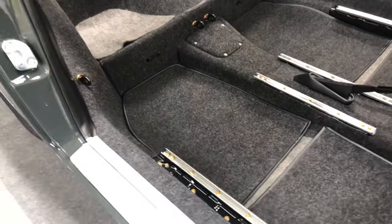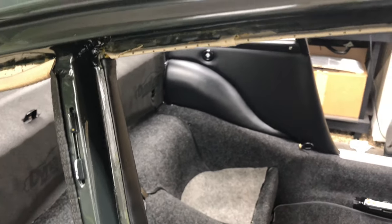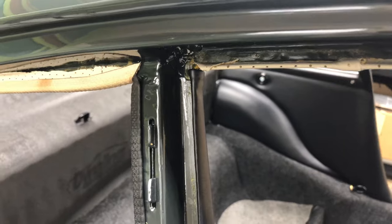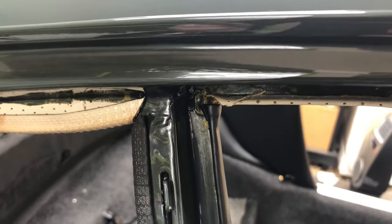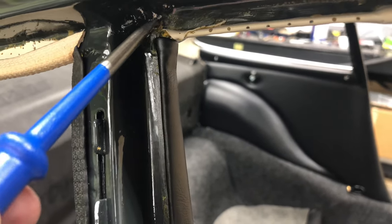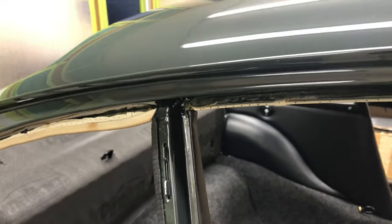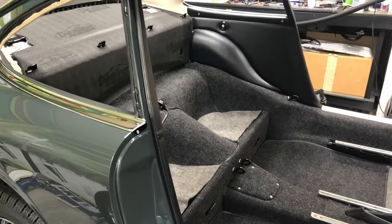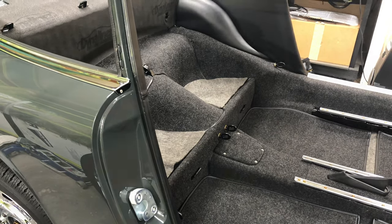Time is creeping up on us again, so let's just try to do one or two more quick things and call it good for today. I wanted to go into some more things but it's getting away from us. I wanted to do these corner moldings here, but there's quite a bit going on with them and that's going to take quite a bit of explaining — we'll save that for a future video. So let's press in our door seals next. The thing to look out for is a buildup and weld in the upper passenger corner rear and the driver corner rear — that's really going to be the locating point. Let me show you what that relief cut from Porsche looks like.